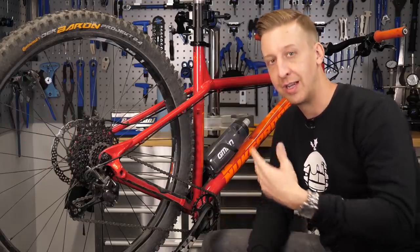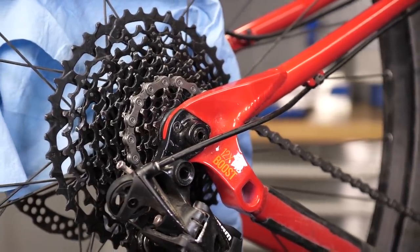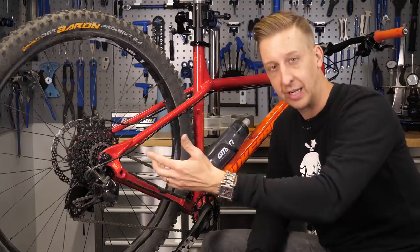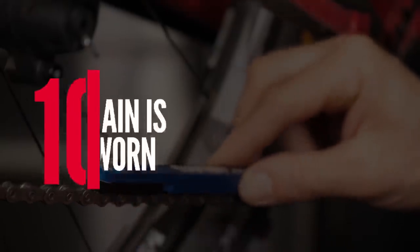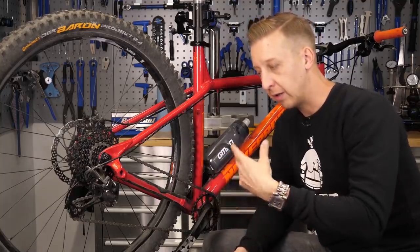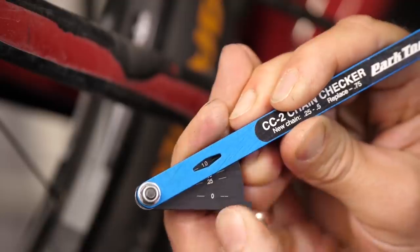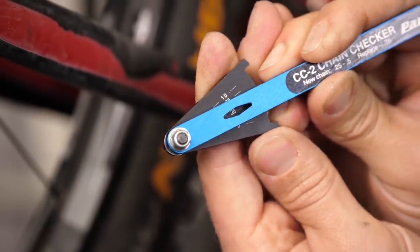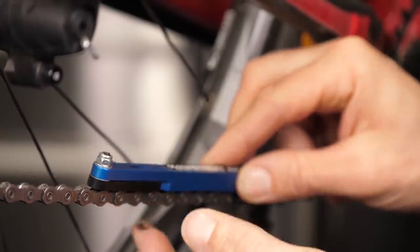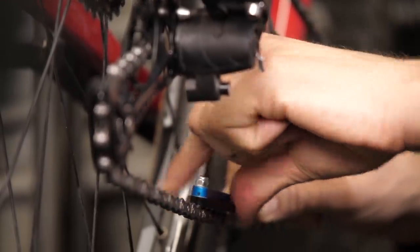Finally, your transmission — it's obviously vital to how well your bike works, and it's not going to work well if it's dirty, filthy and worn out. Start by degreasing it all, cleaning it and lubricating it so it's just like new. Cycle the gears through and inspect it to make sure nothing's overly worn — your sprockets aren't missing any teeth, and the same with your chain ring up front. Now check the chain itself. This varies according to whether it's a 10 or 11 speed chain or a 12 speed chain. With 10 and 11 speed chains, when it reaches 0.75 on a chain checker, that's when you should be replacing it. With a 12 speed chain, you're looking for 0.5 — that refers to how much the chain is stretched. If you replace your chain before it's stretched too far, you'll get more use out of the same cassette and chain ring, saving you money in the long term. So it's well worth investing in a chain checker and monitoring your use.